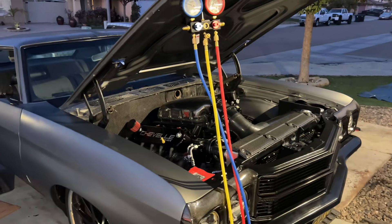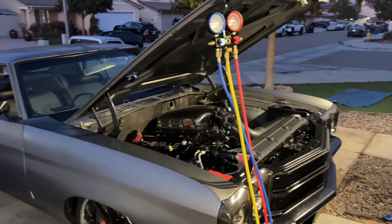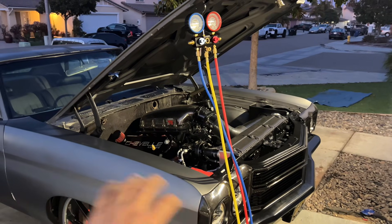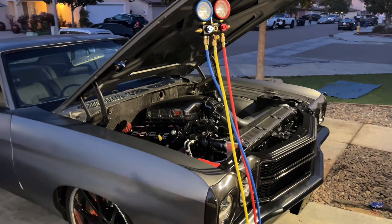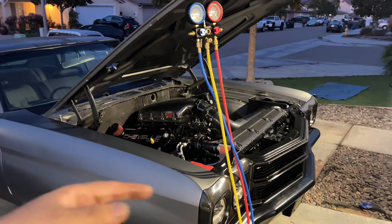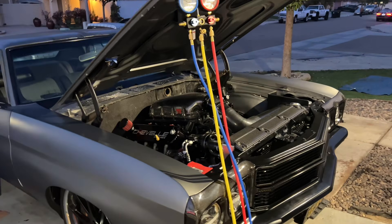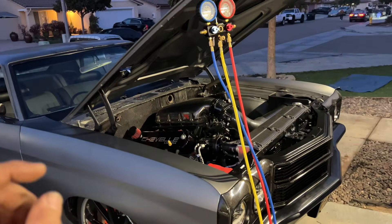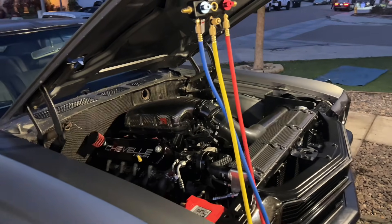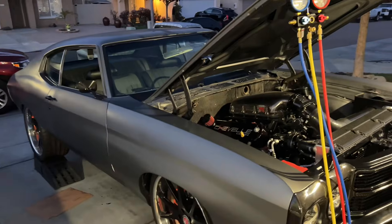What I recommend: as soon as everything is wired up, fire it up, let it idle, adjust the idle, and let it run for about 10 minutes just to get one heat cycle. Then shut it off, take it to the exhaust shop, put the exhaust on, and make sure everything else is good before calling it done. You want all your sensors reading correctly — skip the exhaust step and it's definitely going to throw you for a loop.